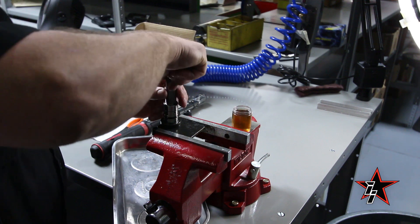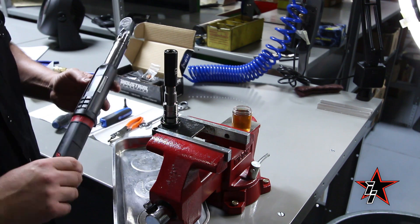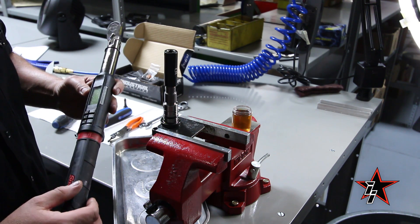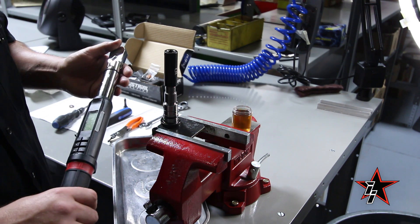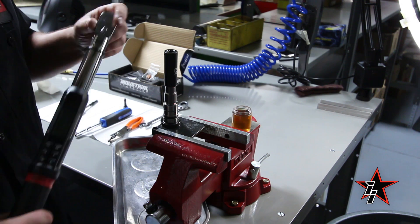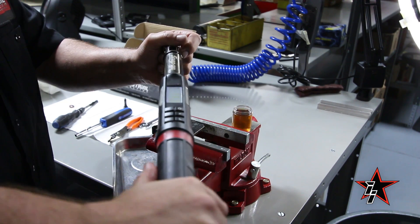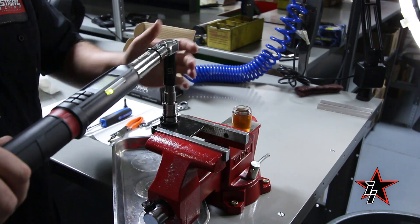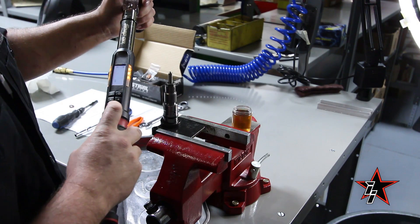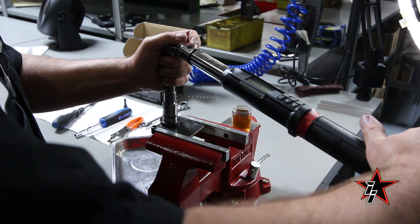I've got an angle torque wrench here. At the end of the video, we'll show you the torque specs for the years and makes of any vehicle we sell nozzles for. On this specific injector, it's a 55 Newton-meter pre-torque. What I'm looking for is a nice smooth motion with no chatter. Then I'll break it loose and do the final torque, which is an angle torque: 6.8 Newton-meters to start, then pull it to 40 degrees.